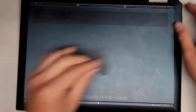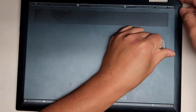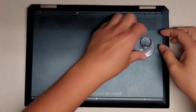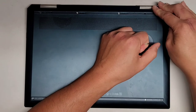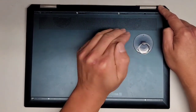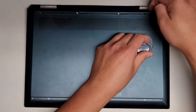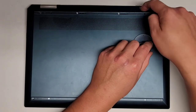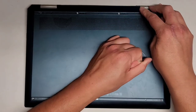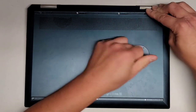We're going to try with a suction cup first because hopefully that's going to work. It looks like it might — it pulls up more from the back. The front only has two screws, so I was assuming the clips down here would be a lot stronger. Usually what I have to do is hold the top down, so when I lift it, it pulls it up, and that curling motion kind of pulls the clips away. Sometimes the plastic part for the hinge goes down in there, so you kind of need to pull it in a certain way.